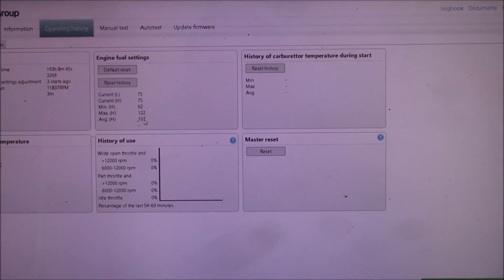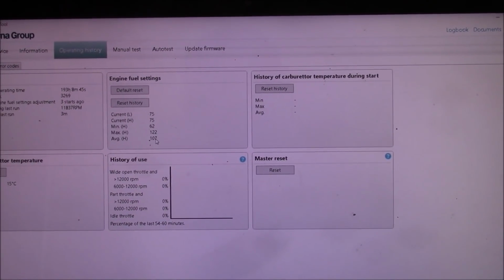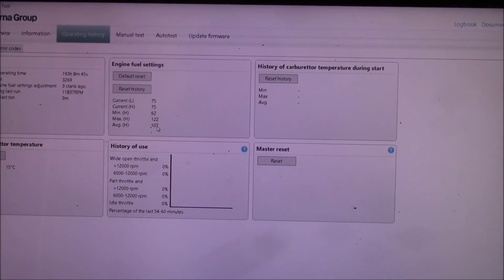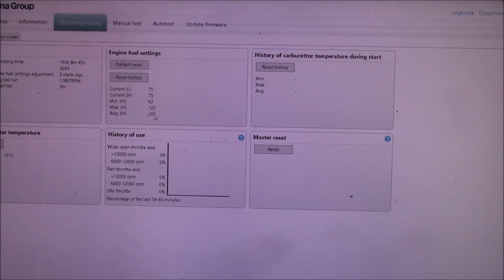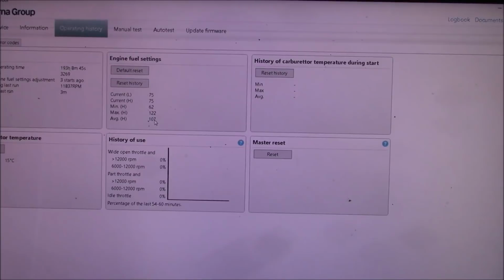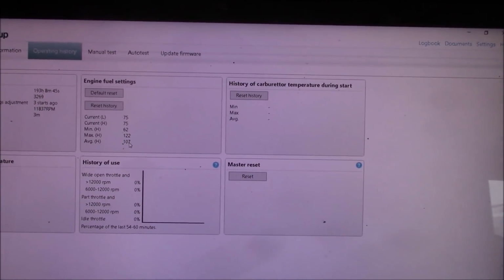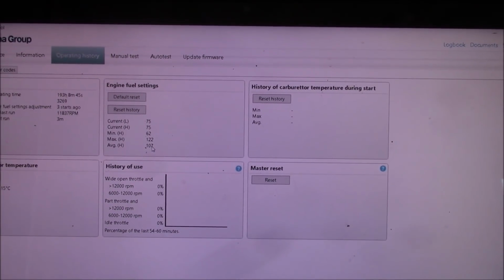And then of course idling. And that's where it comes off throttle, the throttle snaps shut, and then it tries to bring that saw down to a predefined number of RPMs for idle. A lot of times you hear these things, they kind of step down. They drop to a low RPM, then step down to idle. And that's the Autotune correcting the fuel mixture, kind of like you with a screwdriver, adding some fuel or taking it away if it dropped too low in order to get to that predefined RPM for idle. So that does take a little bit of time, which explains to those who are paying attention how come you kind of see the saw drop to an RPM and then work to another RPM on these Autotunes.